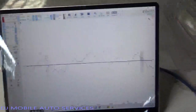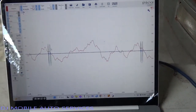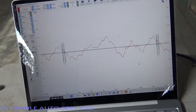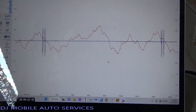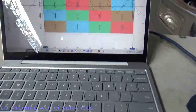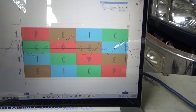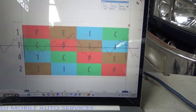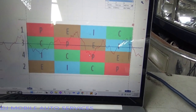What you see here - the blue spikes are my amp clamp on cylinder number one, and basically the red pulse is my exhaust probe. Let me set up my rulers and overlay chart. Right now this is hooked up to my exhaust, synced off of number one, and right here is my number one exhaust.